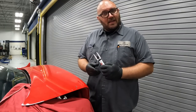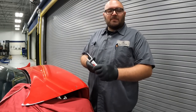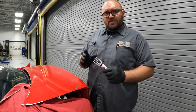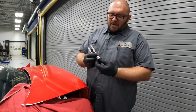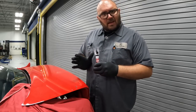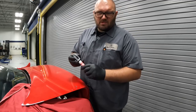And now the moment has come where we have to cover the holes that we drilled with some touch-up paint. It doesn't matter what it is exactly. You're not gonna actually see the paint at all. It's just there to put a coating over the raw sheet metal. We happen to have some performance red, very nice, and it will cover everything up just the way it needs to be. It's not quite Milano, but no one's looking.